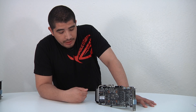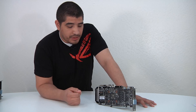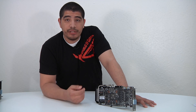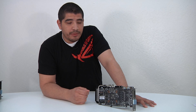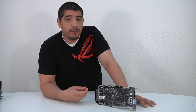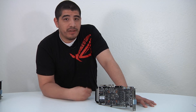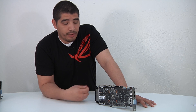On the back of the graphics card there's a lot going on. In terms of connectivity, you have the physical x16 slot, which can operate in Gen 3 if you're using an Ivy Bridge or Z77-based platform. On X79 there is a supported release update from NVIDIA that can potentially enable Gen 3 support, but by default it would operate in Gen 2. In either environment the performance is essentially at parity, so it's not something to be worried about.